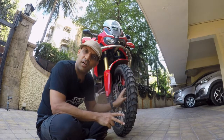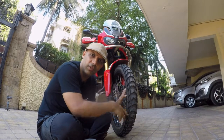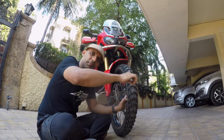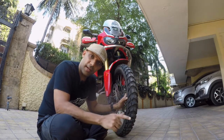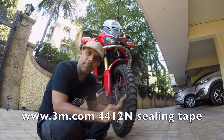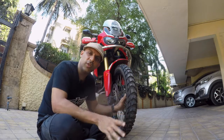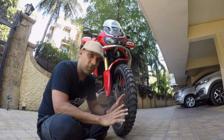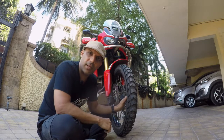After two years with the Outex, I noticed two spokes leaking air and got a flat tire. When I removed the tire, the glue had dried up and the tape came out in my hand just like that — I was back to a tube-type wheel. I did some searching on a forum and on a Ducati forum found a 3M tape that does the same job. I'll put that tape number here. You can use that to seal the spokes without buying Outex — Outex is expensive. Installation is still key: do it slowly, don't rush, because if you don't do it right you'll have to buy tape again and start from scratch.